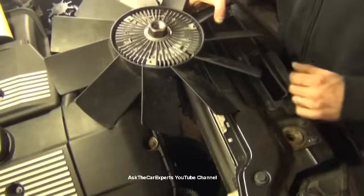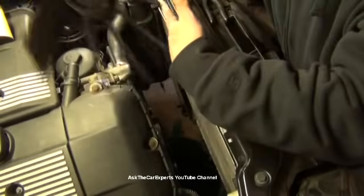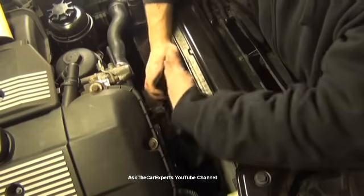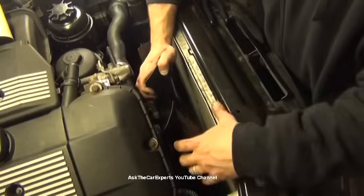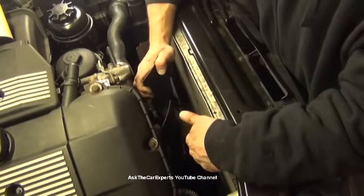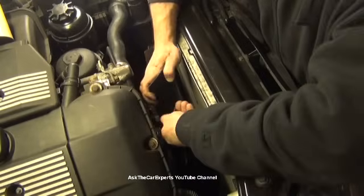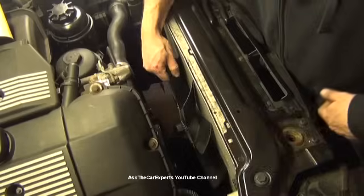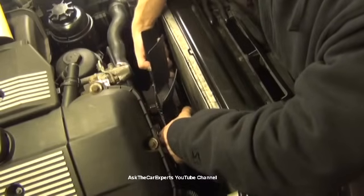Now, if you have the automatic transmission, you're going to have a shroud. So you're going to actually install the shroud, lift it up, slide this in front of the shroud, drop them both together so everything is flush. Just like my mechanical fan fits into some slots on the bottom, that shroud is going to also fit into the slots. This can actually sit right inside up against the radiator,